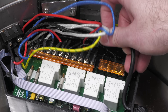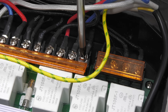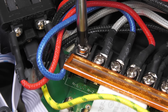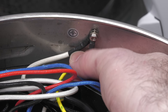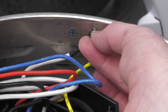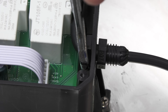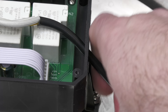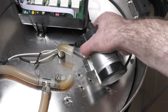As you can imagine, this is a very easy process — there are two wires to remove from these terminals. These two wires are then unscrewed from their respective terminals; in this case they are at opposite ends of the connector block. There is also a third wire coming from the pump to the body of the unit, which is the earth wire — this is also removed. To finish removing this wiring, in this case there are some plastic connectors to undo that secure the wiring onto the electrical box. You can then freely remove the wiring from the box totally and remove the pump fully too. All easy stuff for sure.